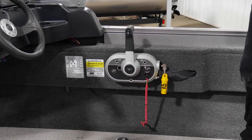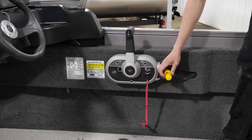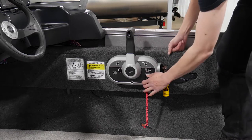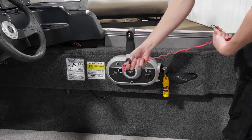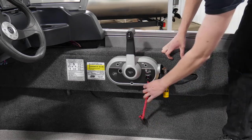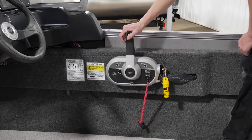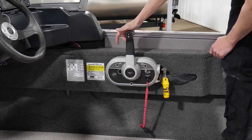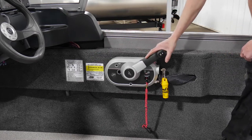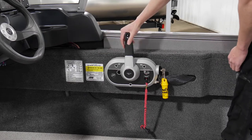So we're going to go over your controls. Your key switch is here — you have a spare key as well, and then you have a float that you can hold your insurance in. Next, we're going to go over your tether switch. It's a switch that says run — if the switch slides down and the tether comes out, you can attach it to your life jacket. Then you can place it back inside and clip up the red tab — that means your motor will run. Next, we're going to go over the trim switch. On your handle, you have trim up and down. And then there's a red handle on the throttle there — you can go forwards for forward, and then you press down and go backwards again to go to reverse. The middle is neutral. You press the throttle-only button here to stop motion of your propeller but to get throttle response out of your motor.